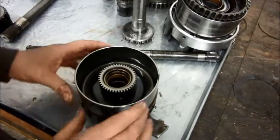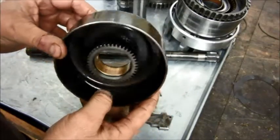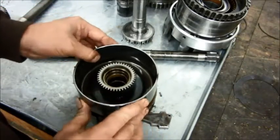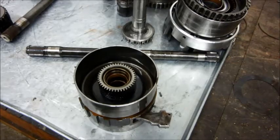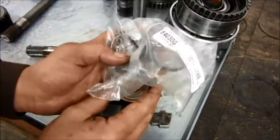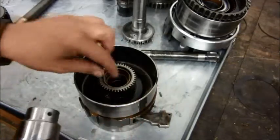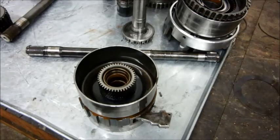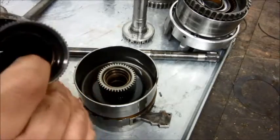Look at that — that's just totally unacceptable. That bushing has probably never been changed since this transmission was made. It'll let this just wobble and you'll have noise and loss of lube oil in just a short life, especially if you push it hard. If it was grandma's car it might run fine like that for years, but knowing this one is going to be abused, that's not going to fly. So I've got a bag of bushings and some homemade bushing drivers — modified sockets — and I'll change those out. That'll help the lifetime of the transmission, and there's another bushing in there that probably needs changing too, which is a pain to get out.